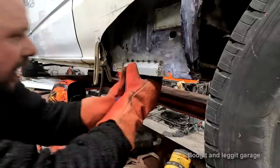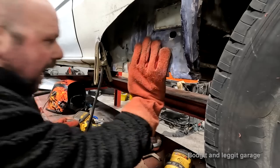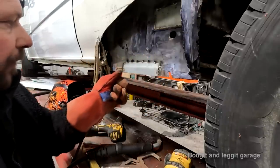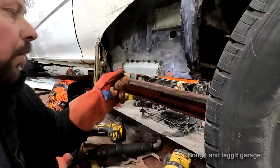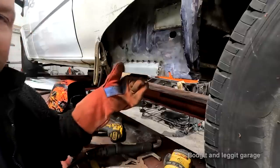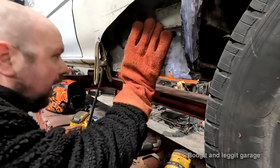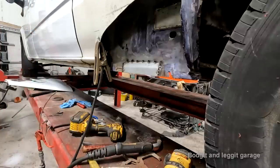So I've cut through both panels. I can now bend this top panel to line up with my old panel. I like to leave, because it's a 1mm disc, I like to leave a 1mm hole, because as you grind, not that this is important, but as you grind it down, if you was to leave a perfect butt joint, not that you can with this method, but if you was to leave a smaller gap, what happens is when you grind down the weld, you're grinding down 99.9% of the weld. It's not going to be very strong. So if you have to grind down the weld, at least you know you've got a 1mm gap internally, which is going to be very strong. So I can now just push that down to meet that bit of weld there. I'll just do that first quickly.